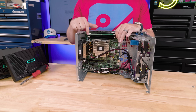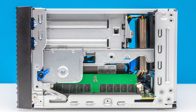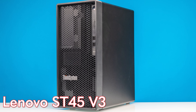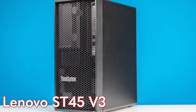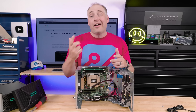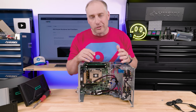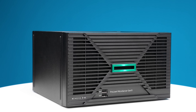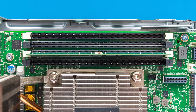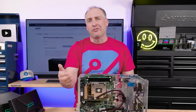Another thing we have here is four DIMM slots — I really like this. You can put 32 GB DIMMs for 128 GB total, or 16 GB DIMMs for a lower-cost option. We recently looked at the Lenovo ST45 V3 which only had two-channel memory — a big miss for that platform. This system supports up to two channels of DDR5, two DIMMs per channel, allowing up to four ECC UDIMMs — unbuffered DIMMs, not the RDIMMs you put in bigger servers.